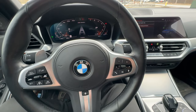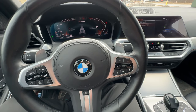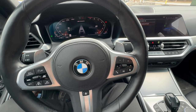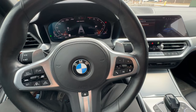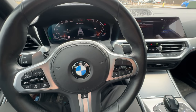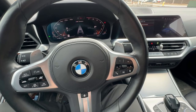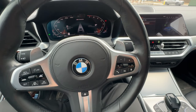My front bumper was scraped at a parking lot when I went to pick up pizza. I believe my bumper is slightly misaligned as a result. One of the sensors for the 360 camera fell off from being scraped — I had to take off the wheel and the fender liner to pop the sensor back in place. After that, the warning for the sensor disappeared and hasn't come back. That was straightforward since I have the tools, but others may not have the knowledge, the scan tool to know which sensor went wrong, or the tools to take off wheels. That could be a $500 to $1,000 bill at a shop if you're not a DIY enthusiast — something to keep in mind when shopping for a car with these features.